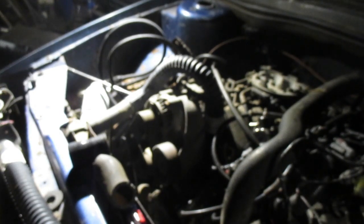I've got a couple more corners to bolt down on the body, and once we do that we'll be driving around, at least around the yard. I still have to do the exhaust, and I've got to build a header — at least for the driver's side. I'll probably do the passenger side too because I don't like things out of balance. I need a header that goes either out farther or in closer — probably out farther — because I want nice gentle bends and curves in it.